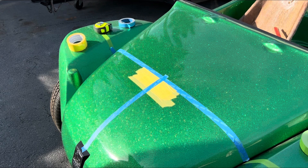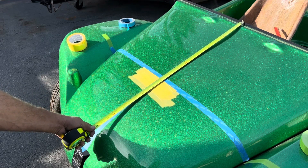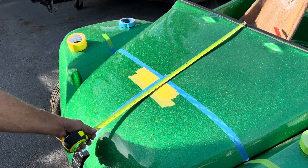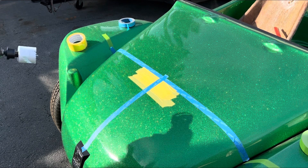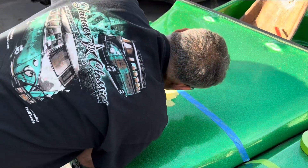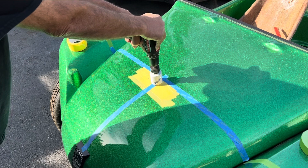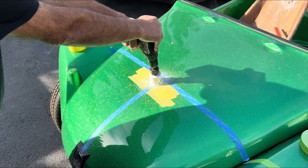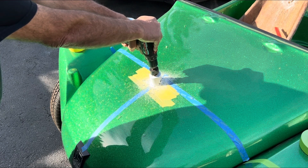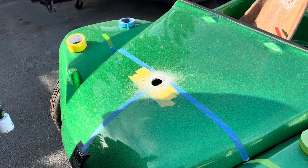The time comes where you can only measure it so many times. Comparing this to another buggy, we took the measurement from the windshield frame at 22 and a half inches on center. We will be putting a two-inch hole in here to accept the filler cap. So here goes, shade and all. And we are through successfully.